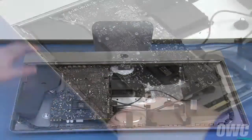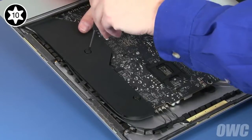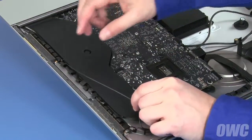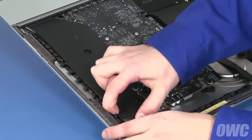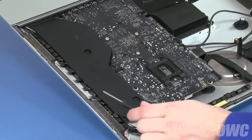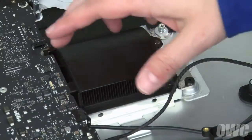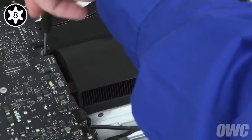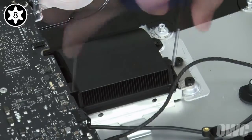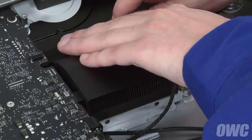We can now move this assembly back into place and tighten the screws to secure it. Then replace the antenna cable in its channel along the side of the unit. Finally, use a screwdriver to gently tug on the fabric loops to make sure none are stuck underneath. Next, we need to replace the heat sink screws. The two screws towards the bottom of the iMac are slightly thicker than the others, so we'll start with those. Then the slightly thinner screws can go in the remaining two spots. Finally, place the plastic cover back in place over the heat sink vent — the residual adhesive should allow it to stick.